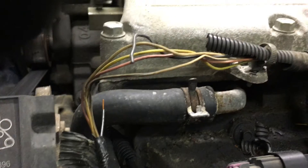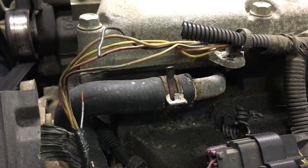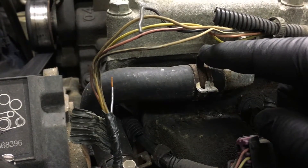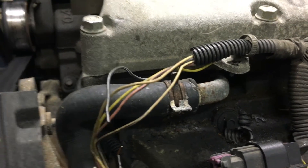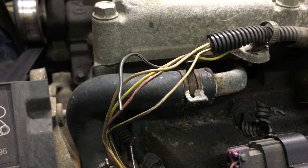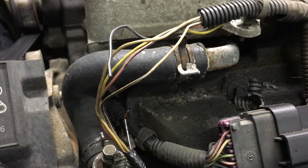Now that I'm seeing this second wire with this little bend here, I'm questioning whether several of the wires got caught around this bolt. To play it safe, I'm going to cut about six inches of wire out and do them all, and then I'm going to put some brand new split loom to strengthen that up again.